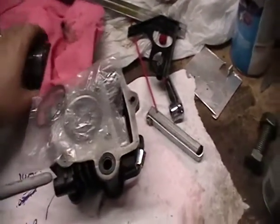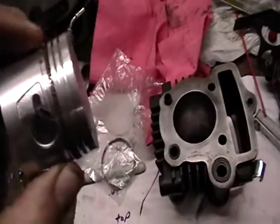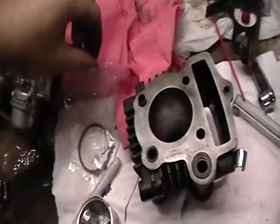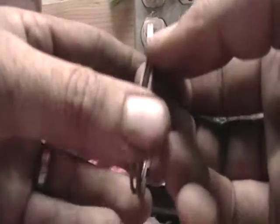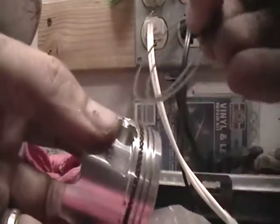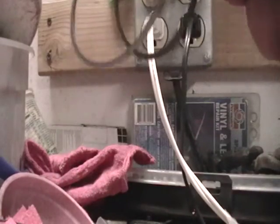Here's where I'm at so far. Got the new piston in. Looks pretty good. I already put the lower oil ring in there. There's two smaller ones that go on there also. So we have all these different rings, and these two right here are really thin — these are going to be the oil seal rings. They go on this bottom groove, one on top and one on the bottom. And then these are your compression rings.